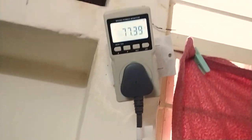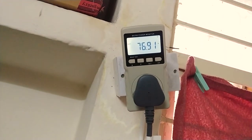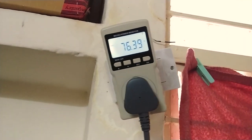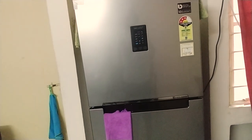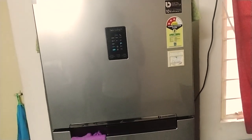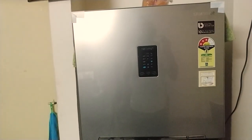I have a power meter here. In the regular idle state it consumes about 77 watts, falling back to around 30 watts. When you first switch on the refrigerator and it runs at full power it goes up to maybe 260 watts, but it doesn't stay there for too long, so you shouldn't really worry about power consumption. One thing I don't like is that when there's a power cut and power comes back, it takes a really long time — sometimes almost 20 minutes — to switch back to full power. Coming to noise levels, it's really quiet, though you occasionally hear a popping sound from the defrost heating element behind the panel, and that popping is louder than what I experienced with LG.